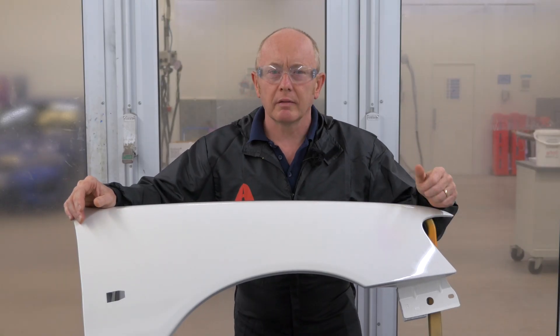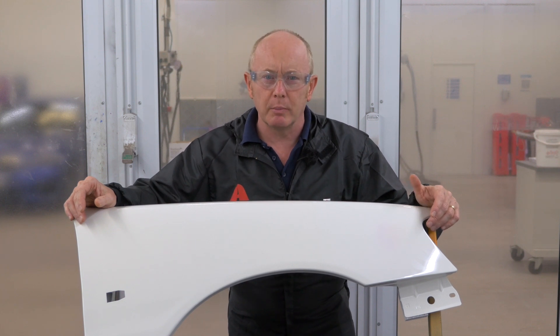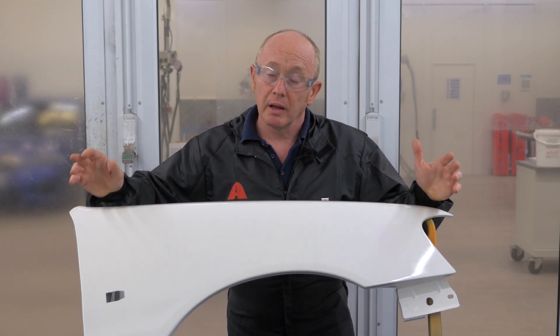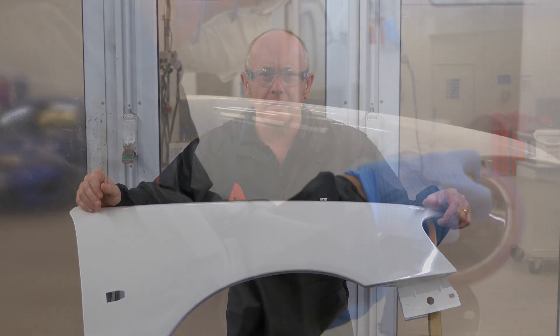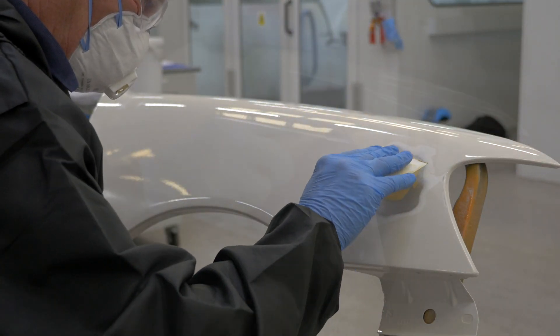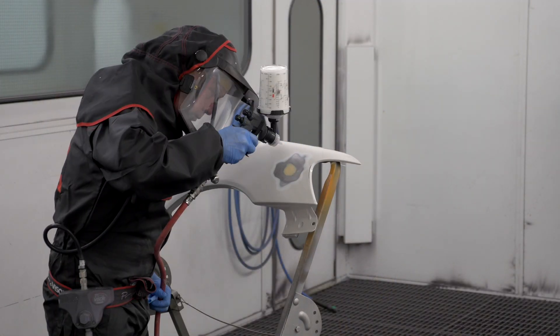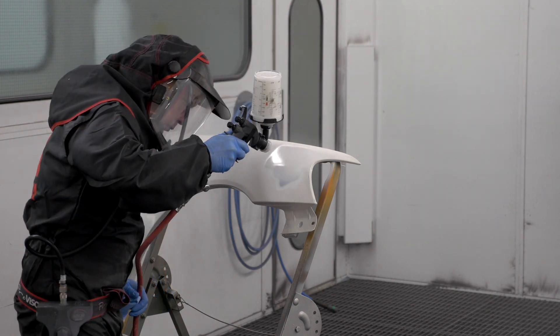Some will say that you can block and cover this bleeding effect by applying a coat of black or fine aluminium colour to the affected area. In truth however, the only recommended remedy is to remove the body filler from the affected area and reapply correctly mixed material. Once done, allow to dry, sand, and re-apply the complete paint system build up again.